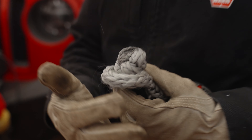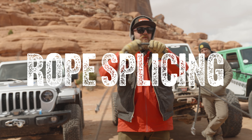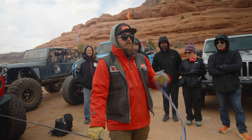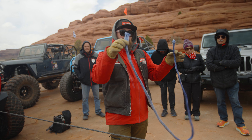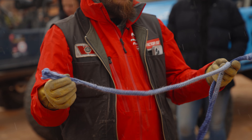So far we've learned about the winch system, the single line pull, the Factor 55 snatch block, and the double line pull. But what happens if your rope breaks? In this next segment we'll look at rope splicing. It's always good to inspect your gear. Synthetic winch line has advantages — it's lighter weight, easier to use, and you can splice it back together if it breaks on the trail. Always inspect the rope because when strands start breaking or UV damage accumulates, it really affects rope strength over time.